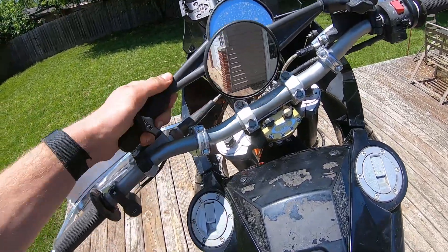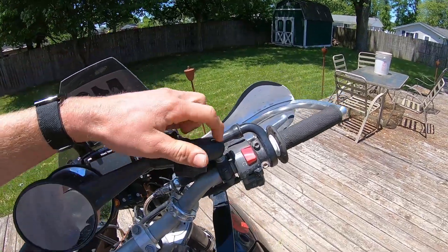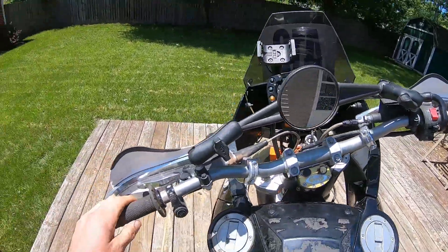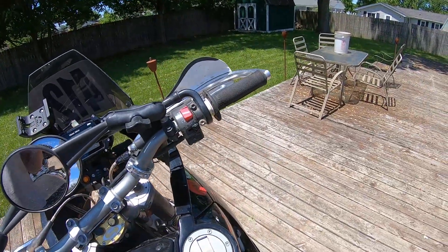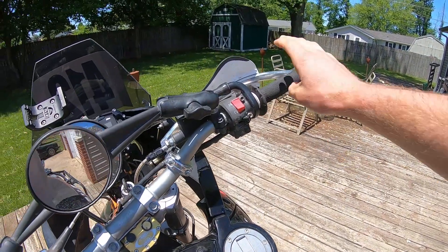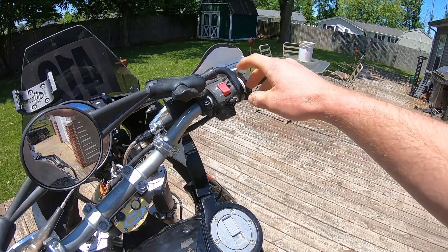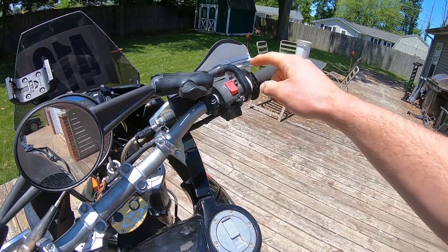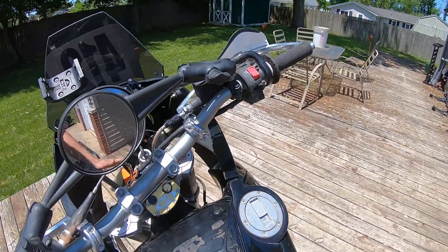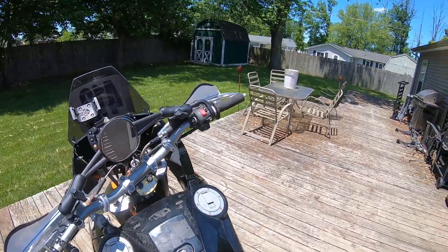Double Take mirrors — they're the best mirrors. They've taken a lot of hits, really chewed up, but they keep on kicking. I do wish you could get an aluminum RAM ball; that's probably something the aftermarket has. Enduro Engineering hand guards. I have ODI Lock-On grips — the same grips I use on my dirt bikes, so all the bikes feel the same. That's one of my goals: make all these bikes feel as close to similar as possible. Stock throttle housing, but the lock-on grips use a different throttle cam, so I modified the inside a little bit — opened it up for the larger diameter. Nice and snappy throttle; it's also a quick-turn throttle. The 950s are not as snappy as the injected bikes, and I like the quick-turn to get to that power more quickly for jumping and such.